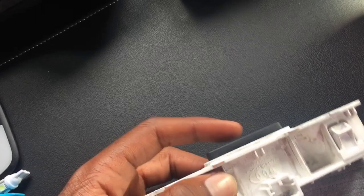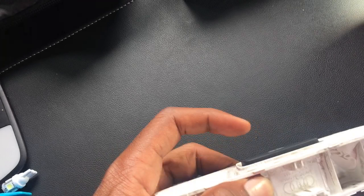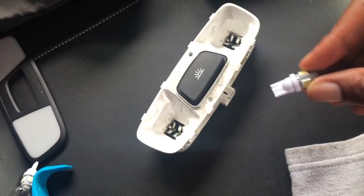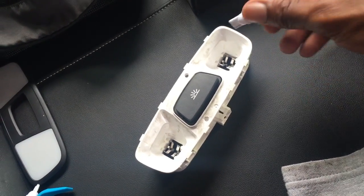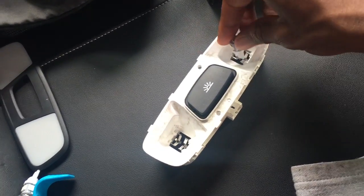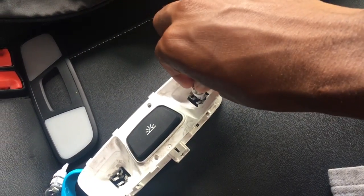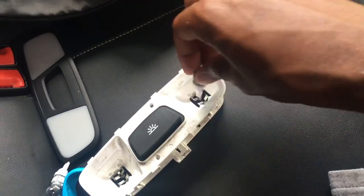In case you've got the wrong bulb, you might have to reuse the old one. Make sure the holder is in the off position — when it's off it's going to be flat, when it's on it's going to stick out a bit. So make sure it's flat. Next, get your bulb. I've gone for these ones — they're not CANBUS-ready but I think they might work. Stick it in — remember they can go either way because of polarity, so if you put it in and it doesn't work, spin it around and it should work.